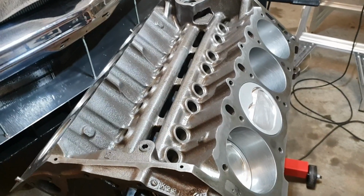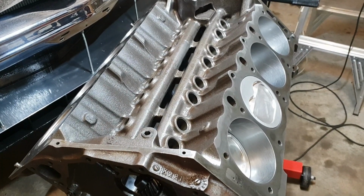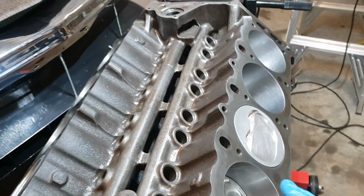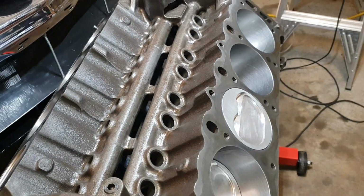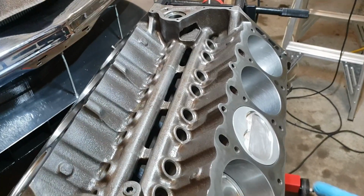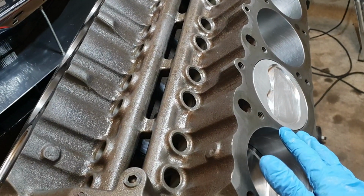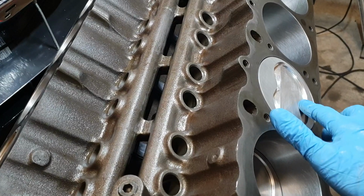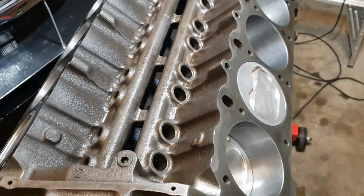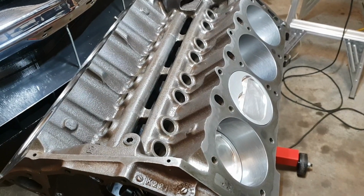I've weighed the piston, so we're within around a gram. With the rod on it and the bearing in it, it was 1,012 before I worked on it. I measured a couple of other pistons and they were 1,007. So I've had to take 5 grams out of it, but that's what it's worked out, guys. When you remove material back to that correct deck height, I actually used a feeler gauge in the dish part here to make sure I was on the money compared to the other pistons, and I ended up bringing it in at the same weight, and it ended up working beautifully.